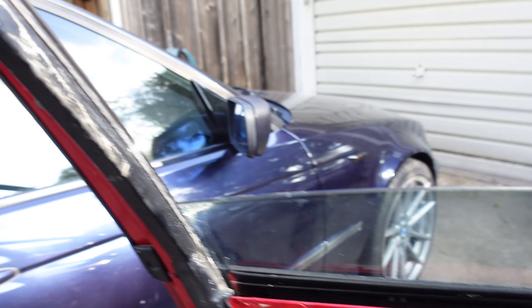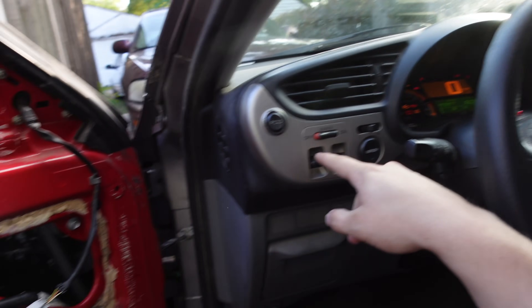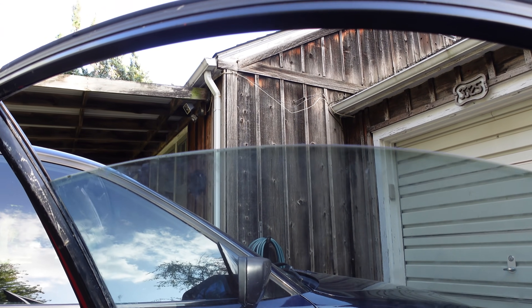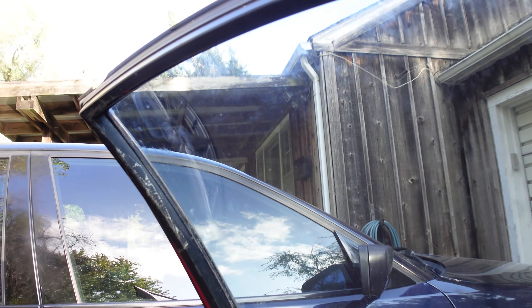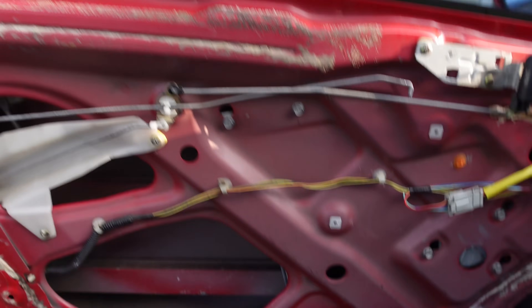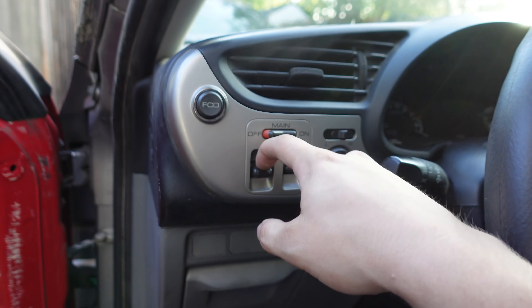The window regulator is in. I took out the glass and greased up the edges as well as running grease all up and down the tracks, and of course greased up the main track itself. Let's go down first - ooh, spicy! But does it go up? That's not bad - that runs pretty good actually. It might work the grease in a little more as it continues to go, but heck yeah! You do seem to lose auto down with the 3D printed part mod.